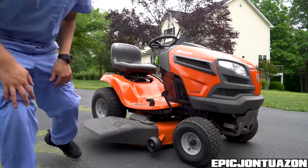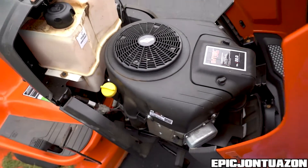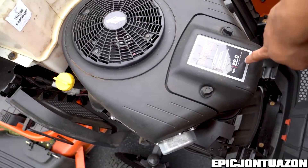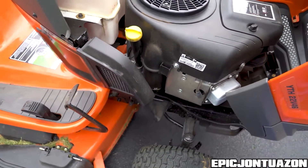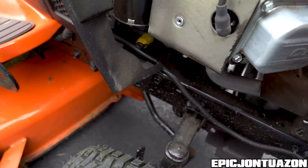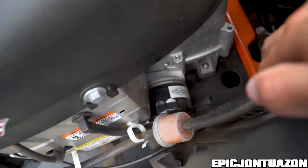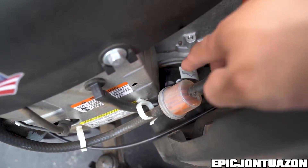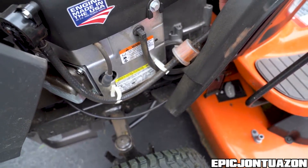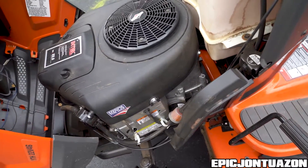Let's take a look at the engine — let's pop it open. To open it, you just flip off the top and it exposes the nice Briggs and Stratton motor. Over here it says 22 horsepower. First thing I notice: here's the dipstick, and the drain plug should be right underneath it — that little yellow thing over there, so we'll have to figure out how to access that. Over here there's the oil filter as well as the fuel filter, which are probably very new since it's still only got 50 hours on it. I'm going to change them either way since I like changing them when I change the oil.